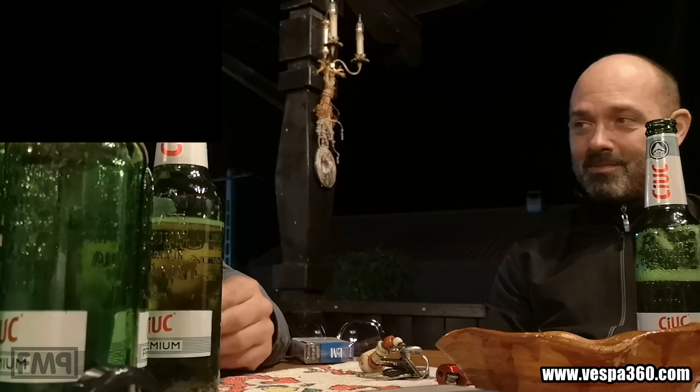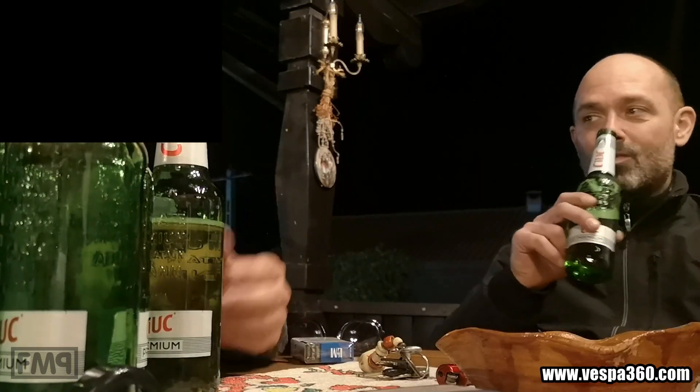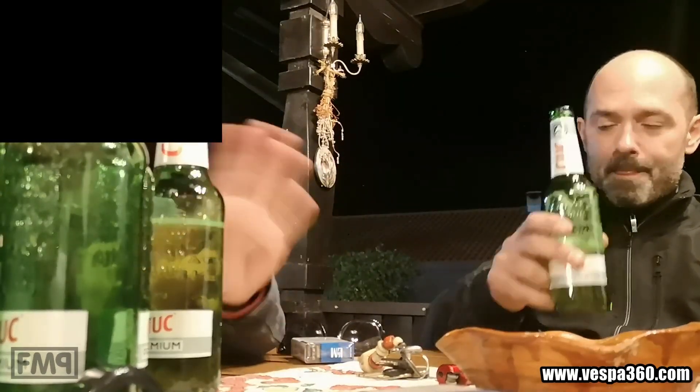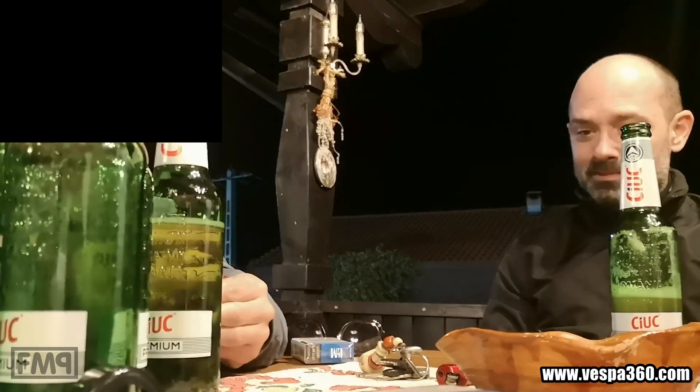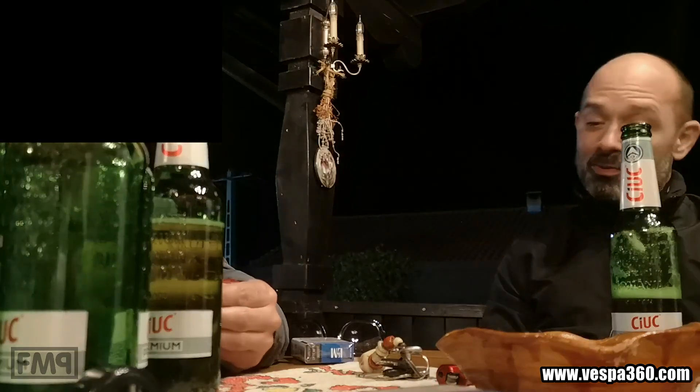It ate a circlip because the last piston was just in there too long — 40,000 k's — and it dropped the circlip, so the rotary valve is pretty scarred up. And it still runs like you would never know. I was impressed.